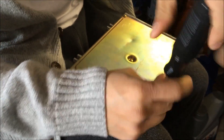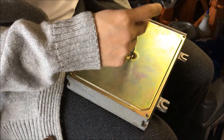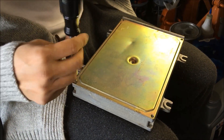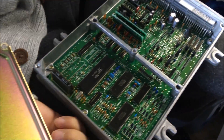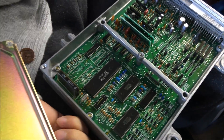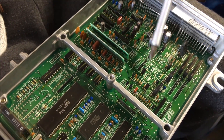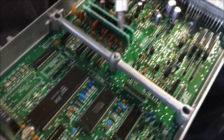Alright, let's see what this one is. Yeah, okay — so this was actually a stock one. If you look at this, '11FO' — this is a newer revision. The old one is a 1720. And then if this was an automatic you would have solenoids right here, but because it's not, they're missing. With the P28 you need these two to control VTEC.